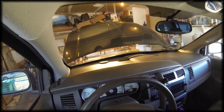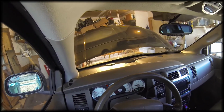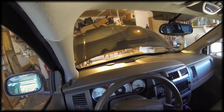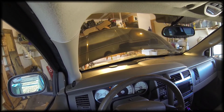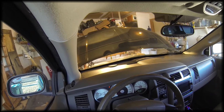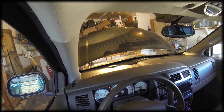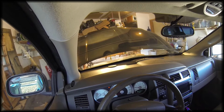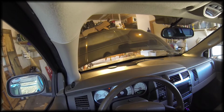And if you'd leave the idler wheel like that for too long, it probably had quite a bit of life left in it, but if you left it for too long, those bearings could seize up and potentially destroy the belt, or certainly would have gotten a lot louder. So it was a $25 part, and it took me 15-20 minutes to do, so it's a pretty easy fix.